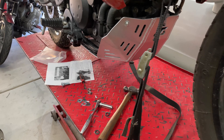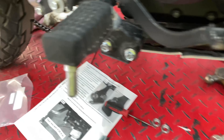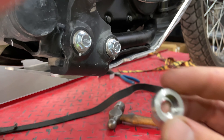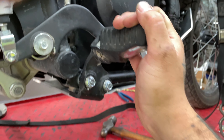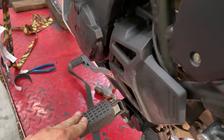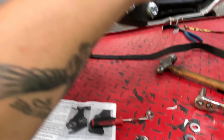Back on the KLR, I'm adding the TUS skid plate. All the bolts are loose because I think I have to have them loose to put the crash guards that are gonna go up here. I'm also doing the foot peg kit. These have rubber washers and grommets right there — you take those out and put in machined hardware like this. This kit's like 20 bucks or something cheap, but it makes the foot peg solid. There's no movement there, but the stock side has a little bit of pressure — you can see how much the foot peg moves. It makes you uneasy when you're riding off road and you're standing. You get all that leverage of your weight and they really feel like they're sagging down, giving you an unconfident feeling when trying to ride off road.